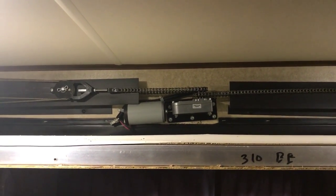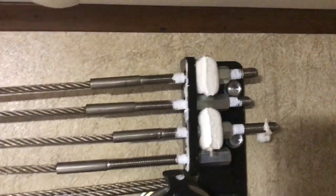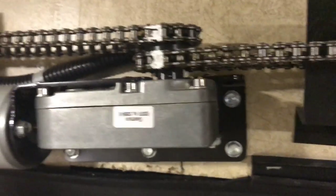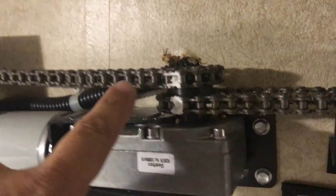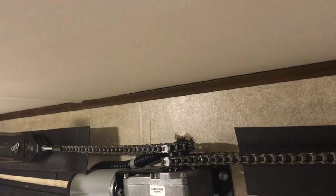Here's what I've done: I used white-out to mark my bolts right where they're at so I know how much thread is on each one. I loosened some bolts on each end. On the gearbox itself I marked white-out on the two pieces of chain — it should be facing straight out when I put the new gearbox on. The only things holding the gearbox are that nut and that nut — they're carriage bolts going through the steel plate up top.